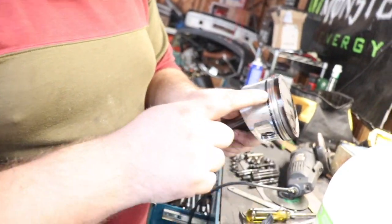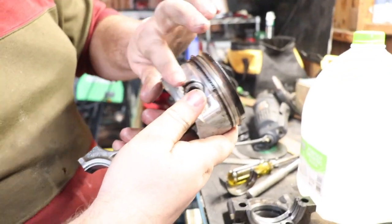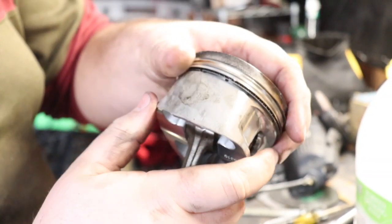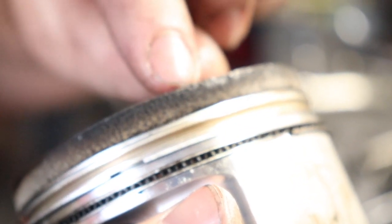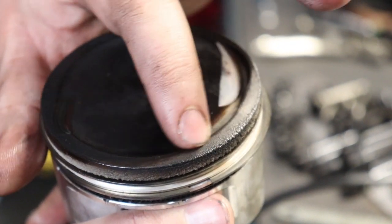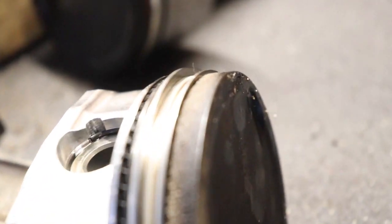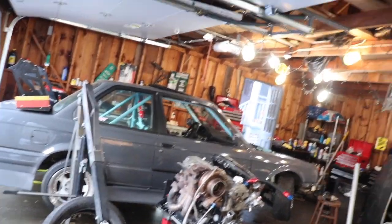The pistons are actually even worse. We thought the pistons would be saveable. The ring lands look fine on the exhaust side, but you can feel this with your fingernail — it's supposed to be completely smooth and machined, and it's a dull rough edge. Up here on this ring land — oh my god — the upper edge is a perfect circle but it cuts down; it's been worn away. From the top it looked fine, but there's some pitting, and down here it's missing heavy material. This is cylinder six and this is cylinder five. The worst ones we thought were one and two, and we haven't even started pulling those out yet.